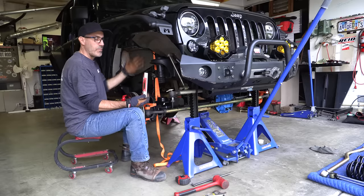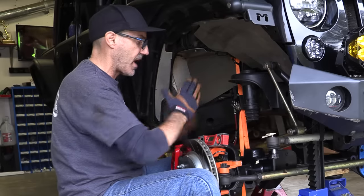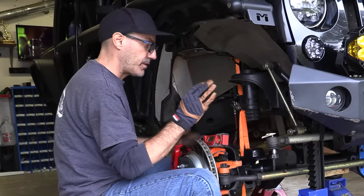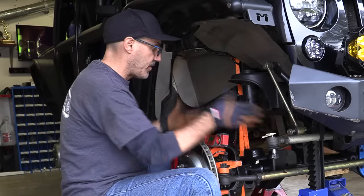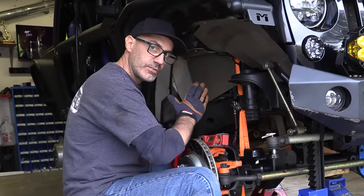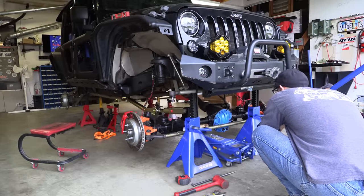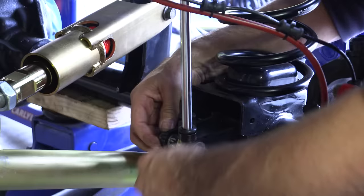But right now I'm just gonna get a baseline with the Jeep chassis at 5.2 degrees of positive caster in this thing, and that's the steering angle tilted back a little bit, and that's a really good starting point. I like that. It was perfect before, so that's what we're gonna go for, and that's by adjusting all of these things. So right now I have the axle, the bottom measurement didn't change from the recommended, the upper I actually tilted back a little bit, so that's how I know that is good to go. So now we'll go ahead and let this thing droop. And then we can put our springs in, shocks in, track bar.